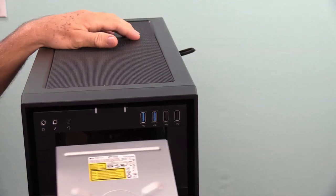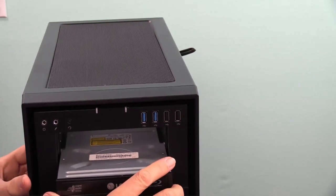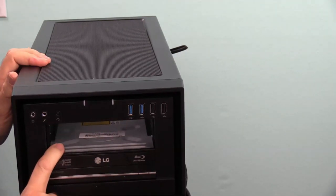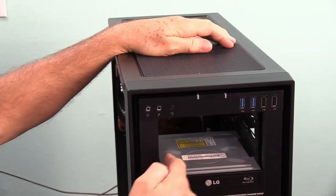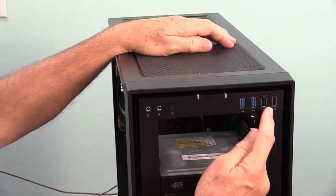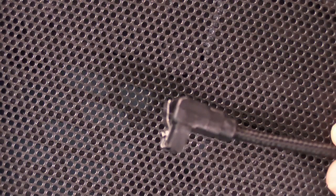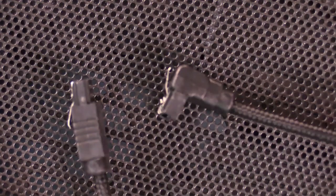These are the two drive bays. We're going to use the burner in the bottom drive bay. For this case - the Corsair 750D Airflow - when we slide this in, there's a locking mechanism on the side; it just slides in and locks. This one space will give us two drives: we'll have a 3.5-inch and a 2.5-inch. So we can get a standard 3.5-inch drive and a 2.5-inch SSD for our media. Then we'll use the top bay for the other device that will give us two more USB 3 ports and a USB-C port. Now because we're putting the drive in the bottom bay, a 90-degree angled cable will be easier to install than a straight one.